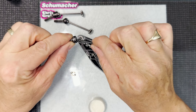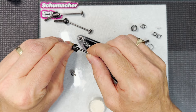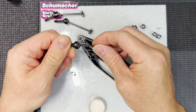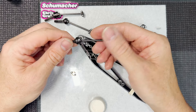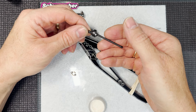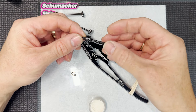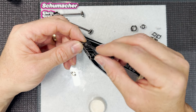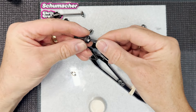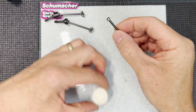To make sure it's fully home, pull the driveshaft down gently so the disc is bottoming out on the axle, and rotate it around. If it's not home it'll ping off, but if it rotates around without pinging off it's in right. Then rotate the driveshaft - the axle or bone should stay sitting on your finger nice and relaxed. If it's lifting up and down, something's tight - maybe the clip's not on properly or you put the longer pin in the wrong end. As long as it's nice and free, rotates and stays in its position, everything is good to go.